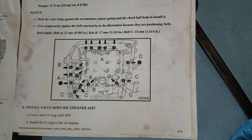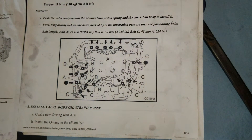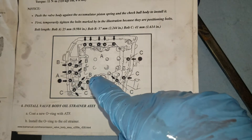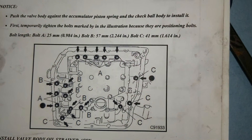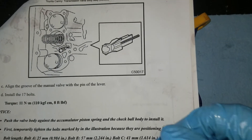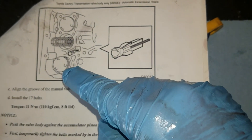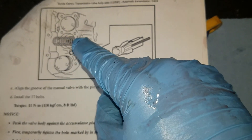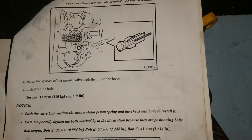I'm going to put this back together off camera, but note that if you had to remove some bolts to make room, the bolt lengths are notated by letter — there's an instruction showing which bolt goes to which location, and that does matter. From underneath, there are a couple of things to check: the accumulator piston needs to be pushed back up, and this ball and spring likes to fall out. Make sure the spring is still in its location and the ball is in its location before you tie it back together.